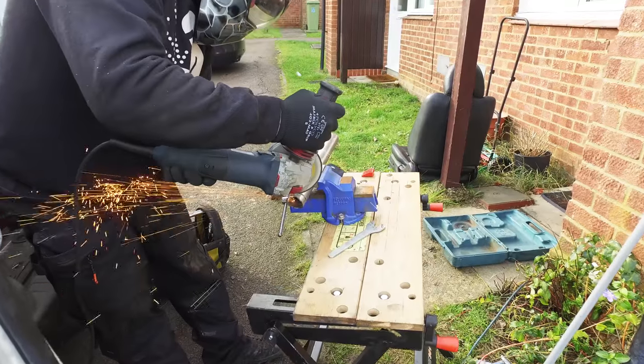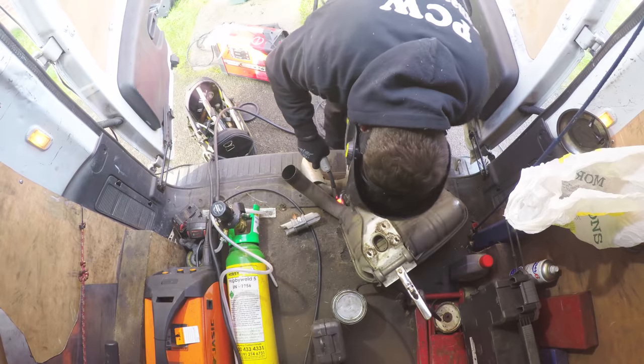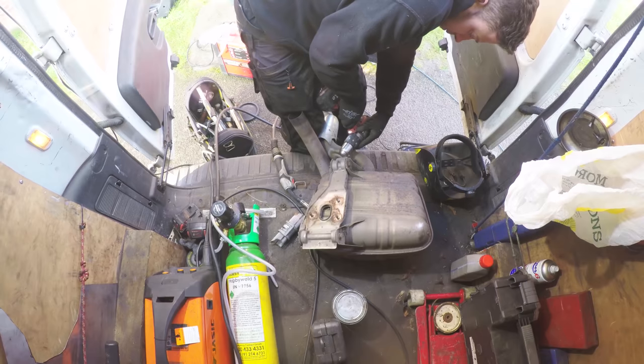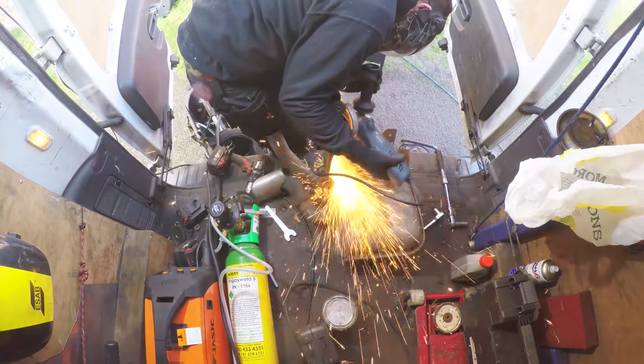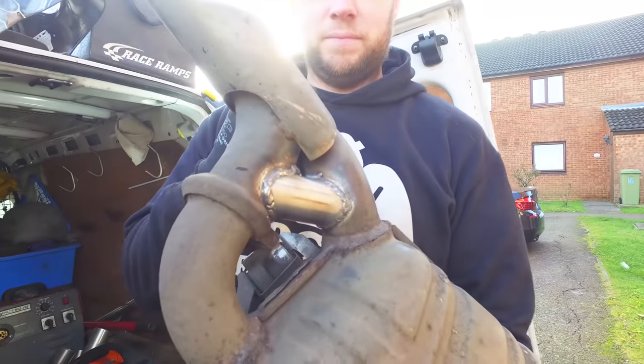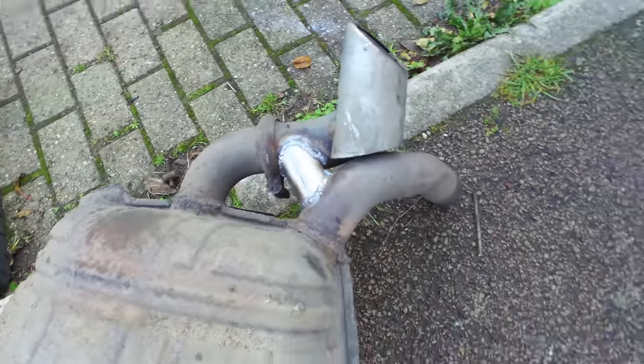Once cut to size, he then uses a plasma torch to cut holes between the two pipes and then weld the bypass in place. This hack basically mimics the rather expensive OE Porsche Sports Exhaust fitted to early 996s, only the bypass pipe on the official part is more convoluted in order to make room for Porsche's switchable valve, which Paul's system obviously doesn't have.